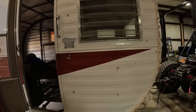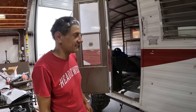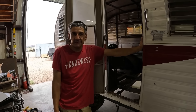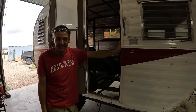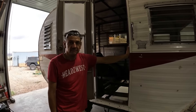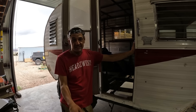That's all we know - I'm just gonna be here recording Mikey. Oh no, the Yukon took a doo-doo on me - it overheated Tuesday/Wednesday, thermostat stuck closed and it won't open. The way I found out was there's no more heat coming out of the vent, so it's not circulating. Maybe the impeller fell off the water pump like my other one - the Lexus. I'm gonna throw a thermostat in it, fire it up and it should be fixed. We'll be in Debec, Colorado all weekend - except Sunday, I got other plans.